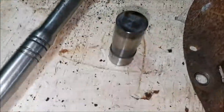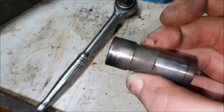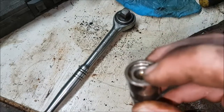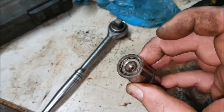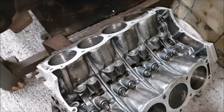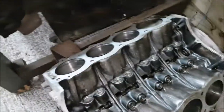That's that one. So, one hydraulic tappet. It takes the oil through a tiny hole in this groove. There it is. Tiny hole, and the oil goes in there. And it pushes this plunger upwards and takes up any gap, any clearance in the valves, and the hydraulic tappets mean you don't have to go around doing your rule of nine tappet adjustments all the time. It is important to make sure there is enough clearance though.